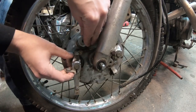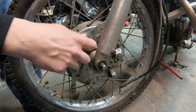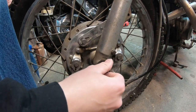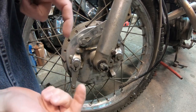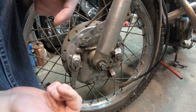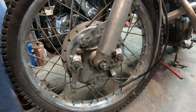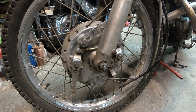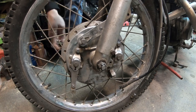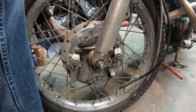With that being said, go ahead and turn this guy up here. I'm not worried about bending it out too far, because as I tighten up the axle nut here momentarily, it will squish it to where it needs to be. And I think what may have happened was I put it together goofy at some point in time, or someone did. I'm assuming it's my fault. It bent it in, but as it ran, it slipped just enough that over time it finally just gave out. I got grease. I got to get a rag here too. So I'm thinking that's what happened. I'll chalk it up to me being inexperienced when I first put this together and not paying attention. Got a little screwdriver here to stick in here to hold the axle. So, I think that's what was going on, and I'm not super, super worried about it.